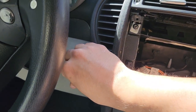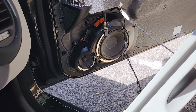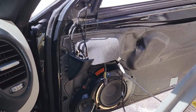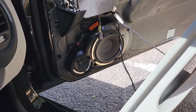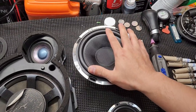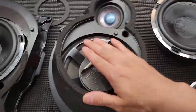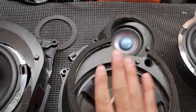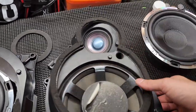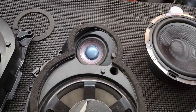Key to position one - a little scared here... awesome, glass clears! This was a success. Now one thing to note, every speaker is different. This one I got lucky, or rigged it in a sense, but it is secure and solid. I just had to mount it in place, shaving off this end to angle it so this lip is flushed on this end, and then obviously mounted here using this hole - this is a factory mounting point right here where this screws in. I just dremeled this cap off and was able to access through there, and it's very strong and secure on that access point.